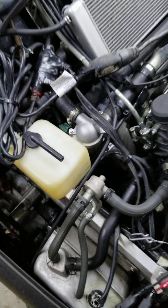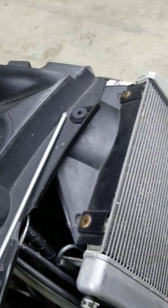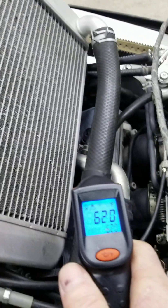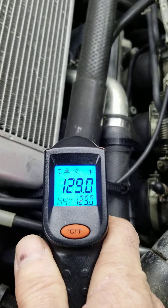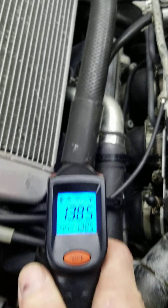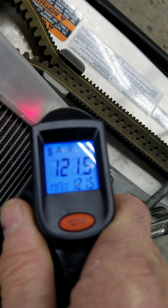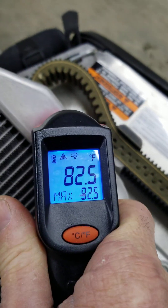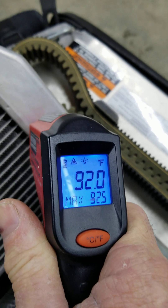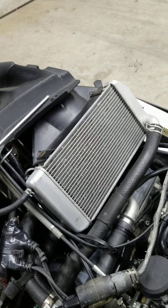Here's where the problem starts. If I measure the coolant hose up here, you can see 129 to 138 degrees Fahrenheit — so we're getting over 100 degrees of heat in the line. Over here, measuring the coolant going into the radiator, it's 112 degrees Fahrenheit. Where it spreads on the wing of the rad going into all the cooling fins, we're getting 107 degrees.